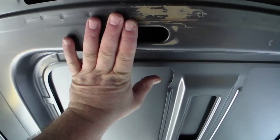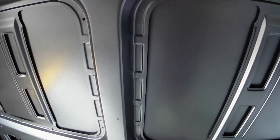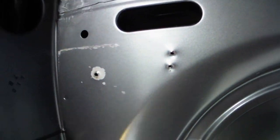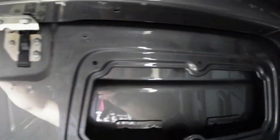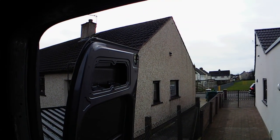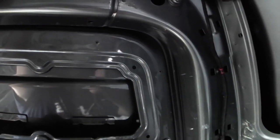When I removed the ply lining from the van we noticed quite a few areas where the paint's rubbed through and there are a few high screws, so we're going to dress these all back and paint the areas where the paint is damaged. We'll tap all these screw heads back and make them good — it's just where self-tappers have gone in and pulled the metal out. It has distorted the metal in a couple of places so I'll lightly tap back with a hammer. There's also a cable here — it beggars belief that 90% of the van cables run inside the van but this one for the back lights runs right over the top of the back doors. So a good couple of hours' work removing the lights and pulling the cables through will tidy that back door area up really nicely.